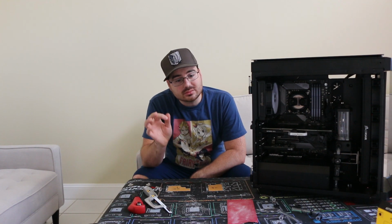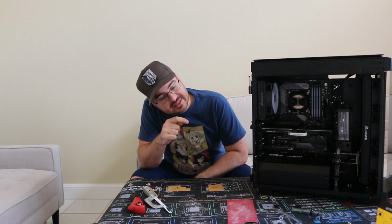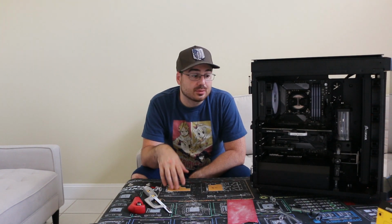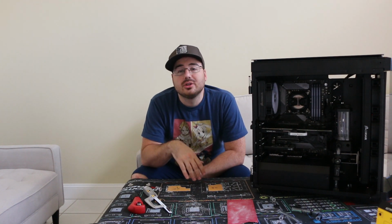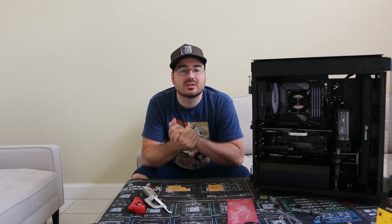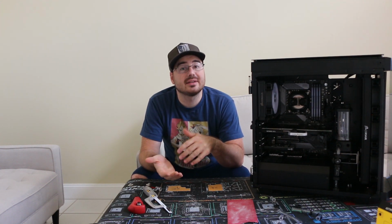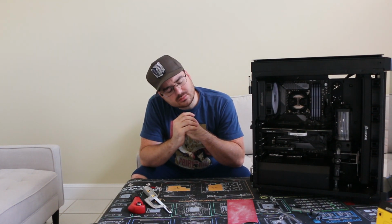Another thing you need to add to your cart when doing the order is a drain. When doing the cart and the configuration, it's not going to give you the parts needed to create a drain. And a drain is very important. What do you do when a year from now you want to change your fluid? Let's say you want to change color, or you want to change the graphics card, or upgrade your processor. How are you going to do that if you can't drain the fluid out? Well, you have to build the drain.